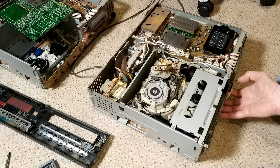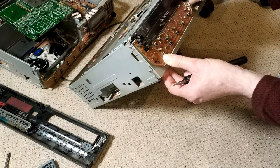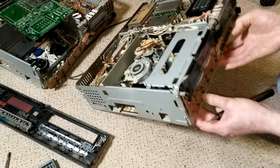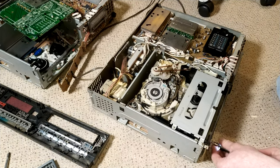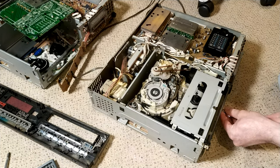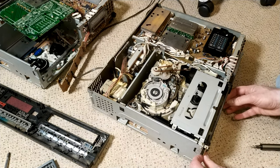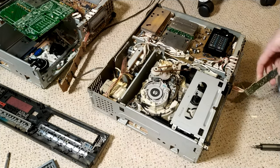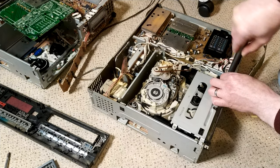It's probably how the door got broken actually — it hasn't got the cable tie to hold the button assembly. As a result, the door would have been striking the cabling and possibly somebody forced it trying to get the door to close and broke the plastic. Not the first time I've seen that. On the other machine the IR unit's missing — I have got that. The display might have gone a bit gassy as well. Not seen that before on a VFD, not on a Sony anyway.